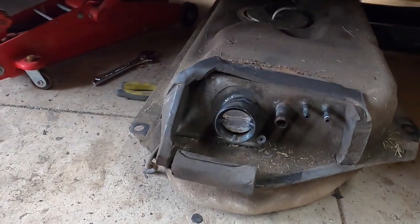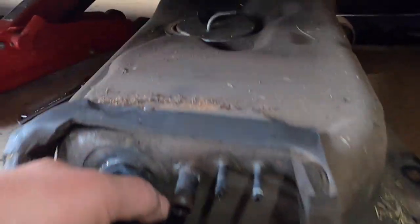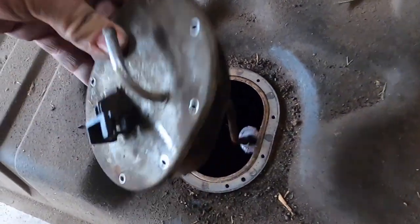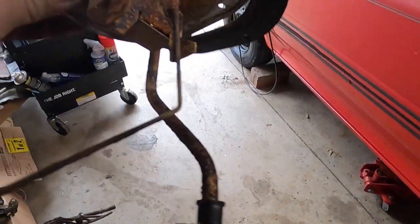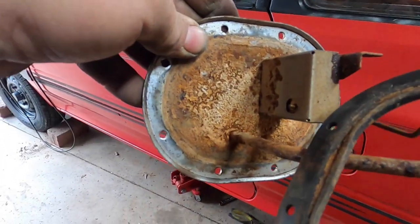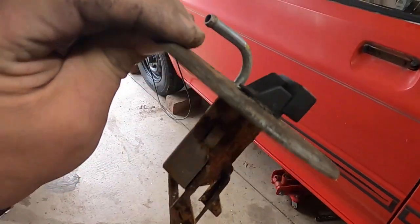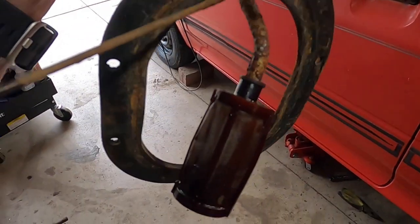Here's the tank — it's got some issues. This port here is really rusty. Here, I'll pull it out — it's just a little guy. I already had the sending unit out. Let me show you everything — totally disgusting. It's way rotted. Some people have said you can take these apart and clean them up with denatured alcohol or soak them. But just look at that — the strainer is screwed. I can't find this unit anywhere. What I think I'm going to have to do is maybe make a plate. For now I'm just going to reuse this one, hose the strainer out as best I can, and stick it back in.